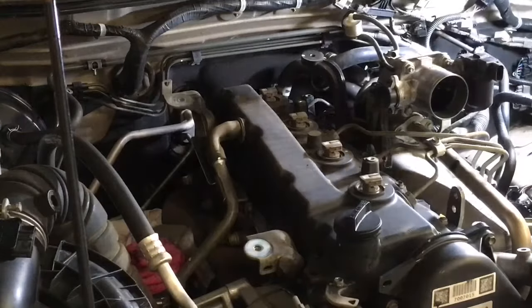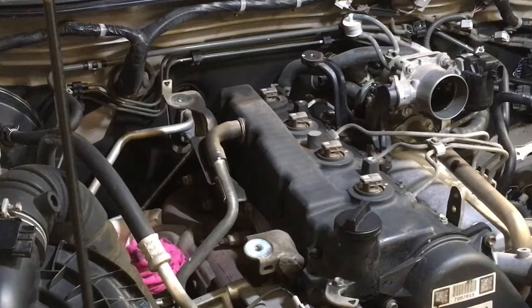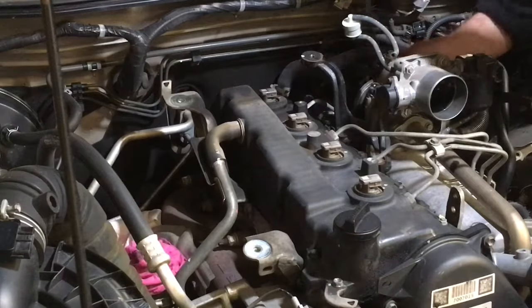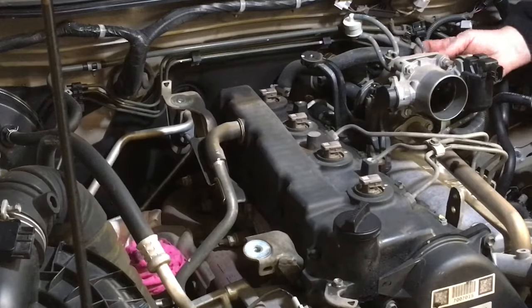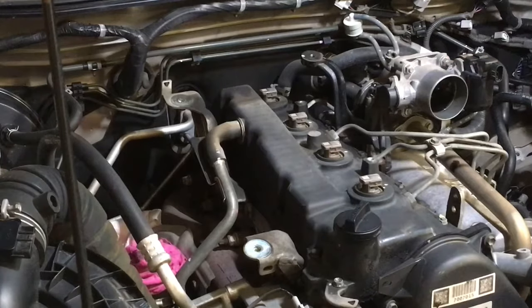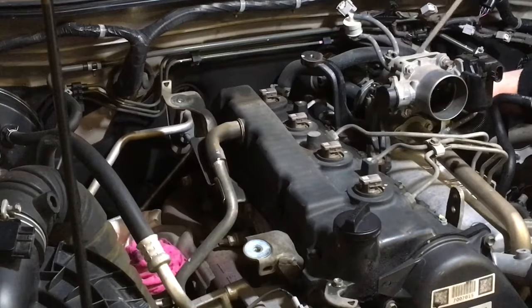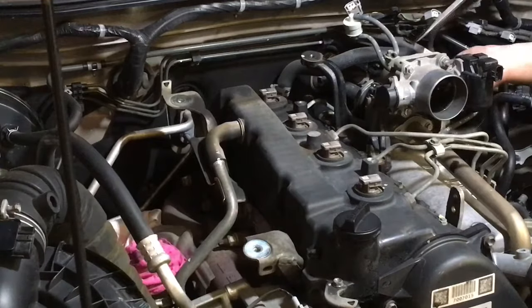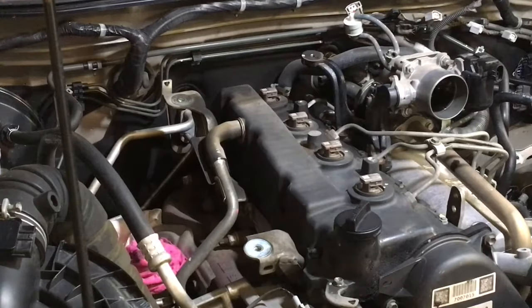Okay, so two vacuum lines on the back of the EGR valve. So we'll get our big flat screwdriver we like for those. And get in behind those, lever those a bit while pulling with the other hand. That's one. It's the one with the white filter goes at the top, okay? And then there's one further down. If I can find it, come on over here. Okay, that's off as well. And we've got, I think, two on this model, two 12 mils.